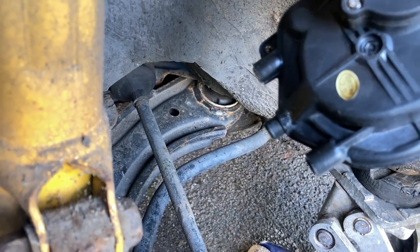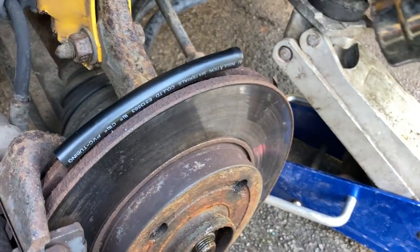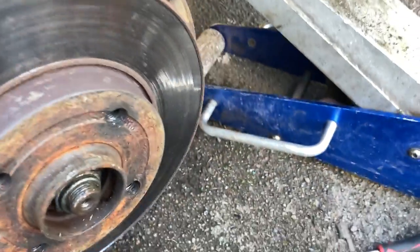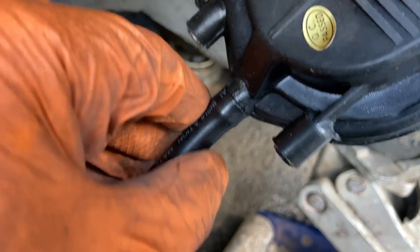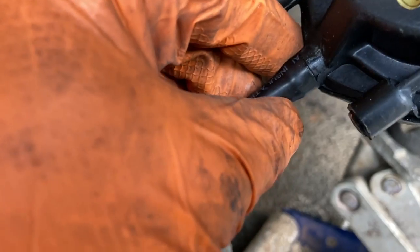The drain tube has to go onto the power antenna module. Because it's cold and they need a tight fit, it's almost impossible to get it on there securely, so I'm just going to heat it up with this heat gun. If you haven't got a heat gun, I'd recommend you get one because they're so useful. Now that it's a bit more malleable — that's now on really securely. As it cools down it will take the shape of the module and stay on there.